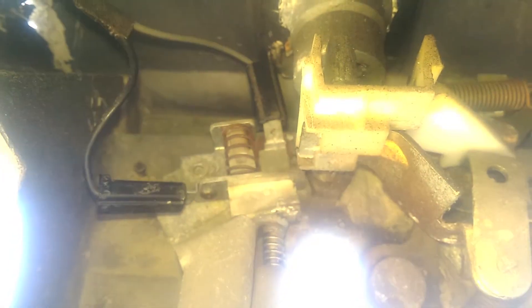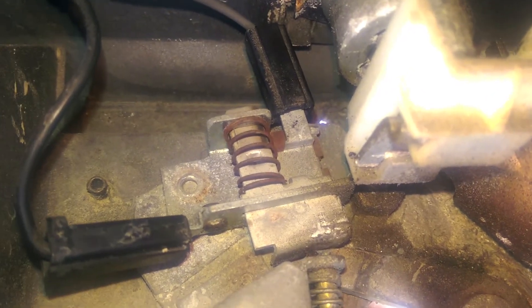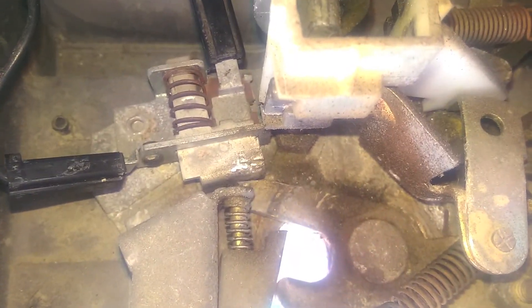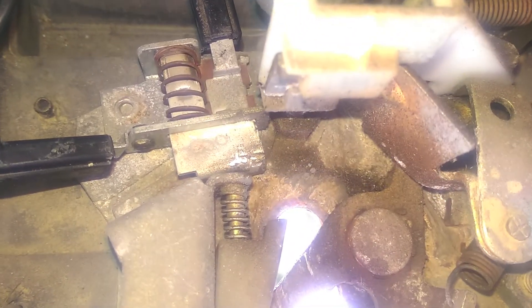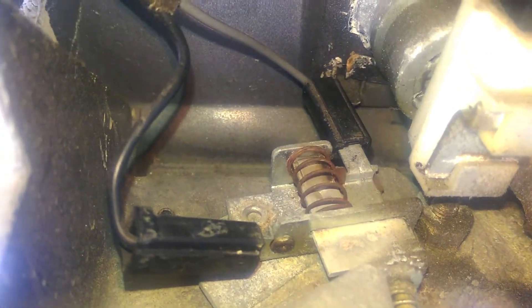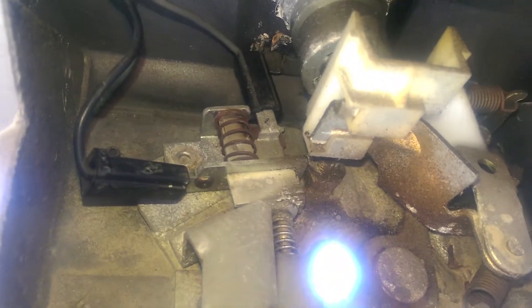This gray wire right here is what controls the switch. You can follow them through this hole, and here's the mechanism itself — this whole mechanism is what operates your hatch switch. When it's closed it makes contact, and when you push the button to open it, it clicks down and something makes contact. The gray is the switch wire and this blue one is a ground. So if your hatch isn't working, the first thing you want to check is whether this switch is working.